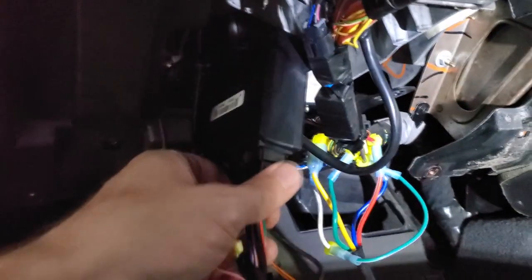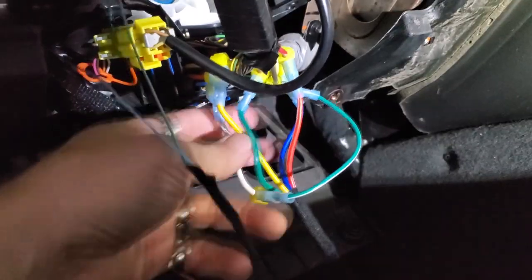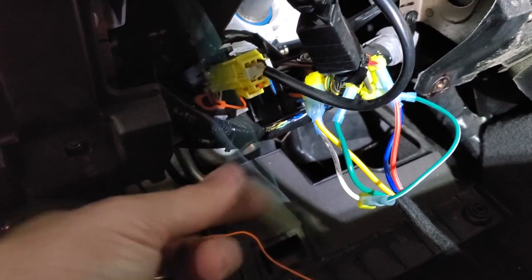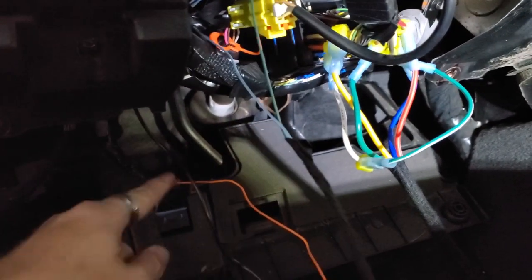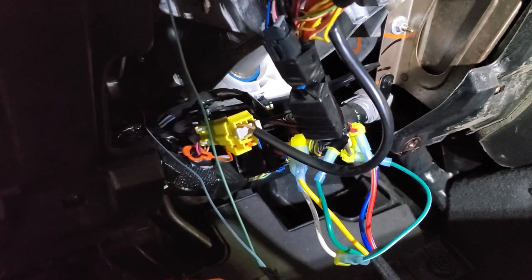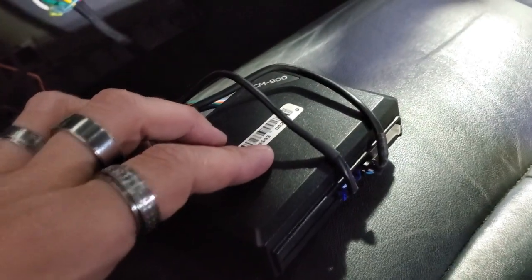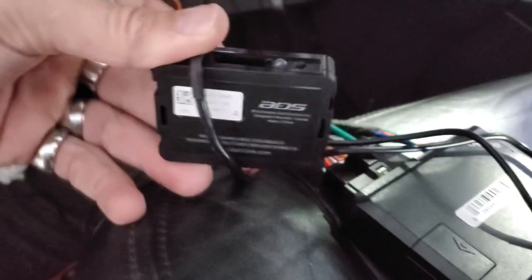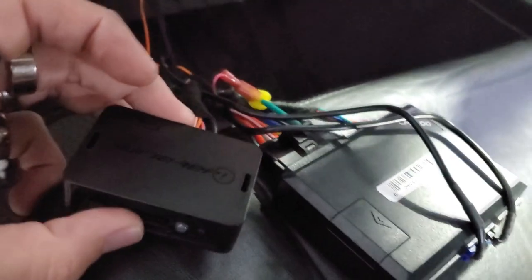We've got every single thing wired up. Here's our brain, and here's all of your ignition wires connected in. We've got our parking light wire going up to the parking lights, our brake wire going to the back, and our data wire going down to the OBD-2 purple wire. That's pretty much everything you need to make this remote start work. All you have to do now is program the remotes by cycling the ignition five times and leaving it on the fifth time — that will program your remotes. We've already done that and ran our antenna up. Next you'll need to program the bypass — I'll put the instructions on how to program the ALCA. It's very simple, takes about 10 seconds, and then the remote start will work.